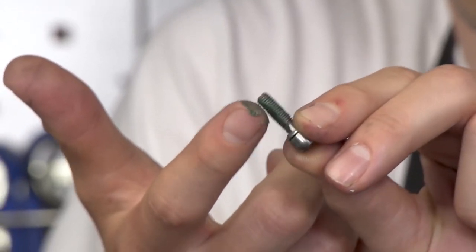Also a brake lever assembly — those bolts that go through and clamp the brake levers onto the handlebars. I've taken off handlebar tape on people's bikes in the past and it's been absolutely disgusting. The amount of salt that has come through sweaty hands through the bar tape has almost corroded through the bolts there. So by greasing them, you're going to do yourself a favour in the long run.